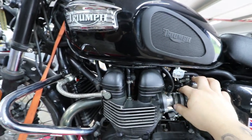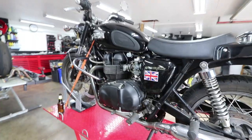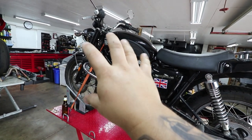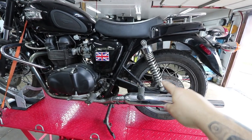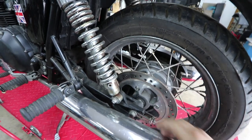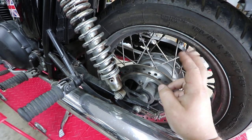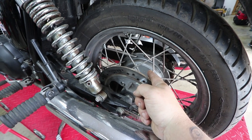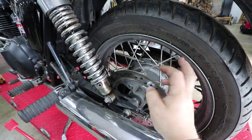I'm going to take the risk and run it with the fuel tank as-is — fill it up with fuel and hopefully not gunk up the carbs. I typically don't like doing that, but I really want to know if the bike runs and if there are any other issues. However, Cognito Moto already started building pieces for the front end conversion and they really need this hub in order to lace the brand new rear wheel. I need to pull the wheel and tire, pull the brakes off, remove the sprocket, unlace the wheel, get the bearings and seals out, send the hub to the powder coater, and then ship it out.